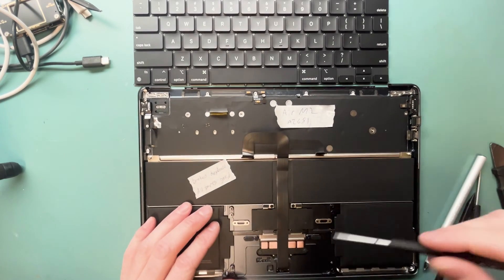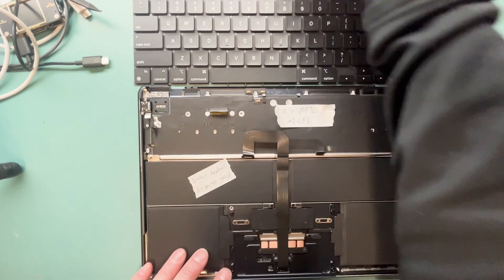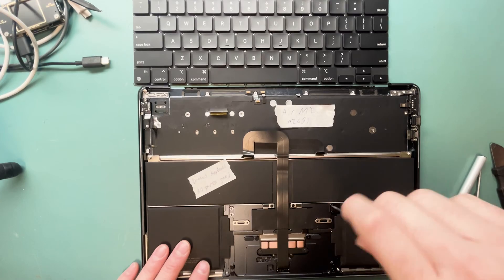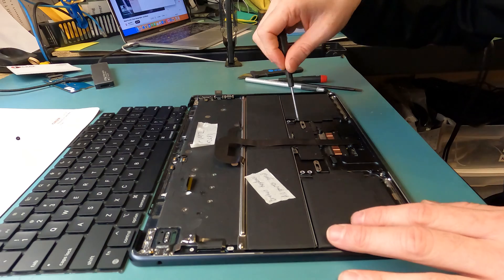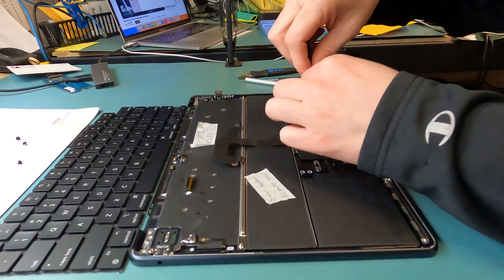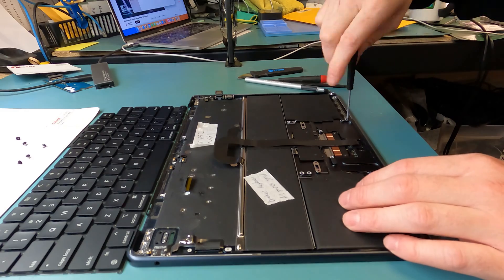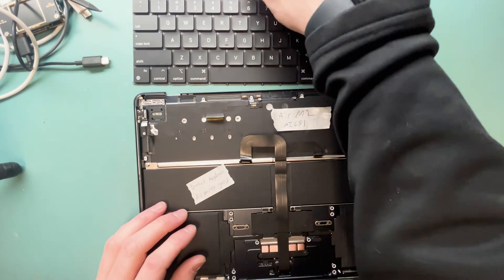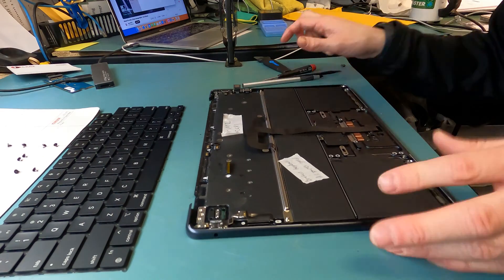Hello, it's Mark from Werther Repairs by Mark, and today we're doing a MacBook Air M2 chip A2681 keyboard replacement. We'll grab our T5 screwdriver and unscrew the trackpad so we don't bend up the cable and break it when we're doing the repair. This repair is for experts only. I do not recommend it if you're just starting out and trying to replace your keyboard — please check out my video in the description, top case keyboard replacement, which will be a much easier repair for a beginner.